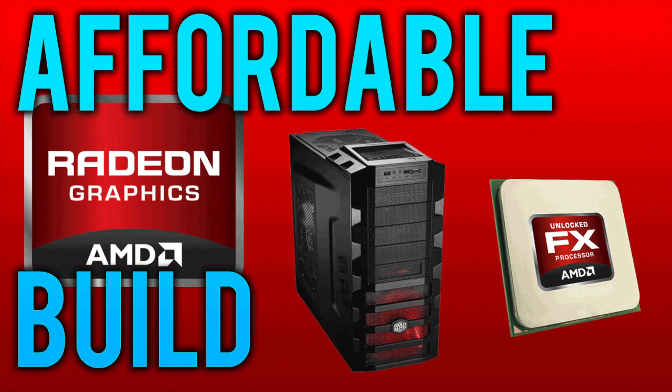And there you go — that is the AMD affordable build. Basically our goal was to create something under $700 just for the components alone, and this is a very good value for what you pay. If you're serious about getting into high-end gaming, this could do a really good job because the 260X can handle high-end games like Battlefield 4. And if you aren't getting the performance you need, you can just add another GPU for $150 and you have a nice Crossfire setup — you could even set up Eyefinity and have a lot of fun with it.